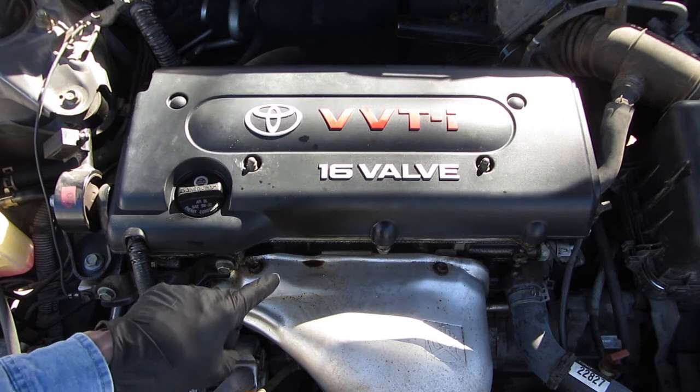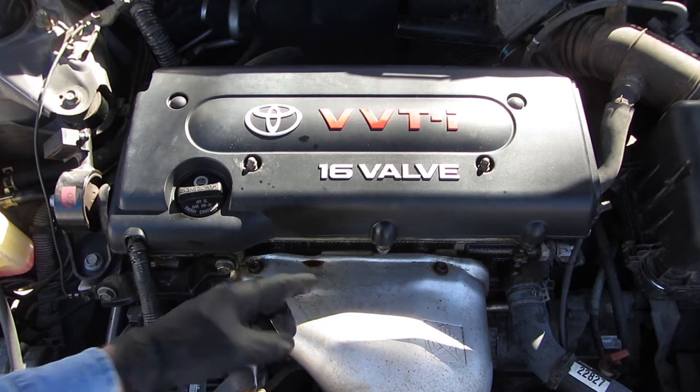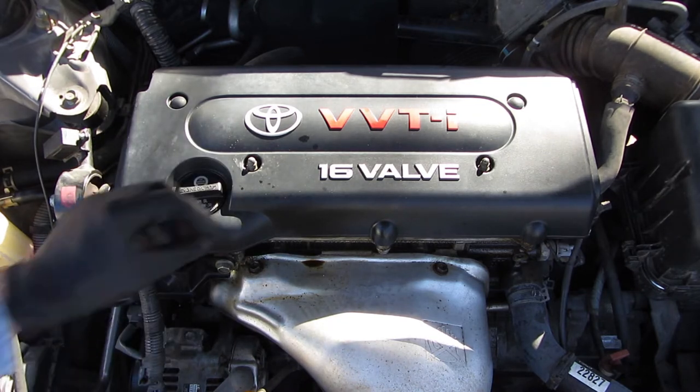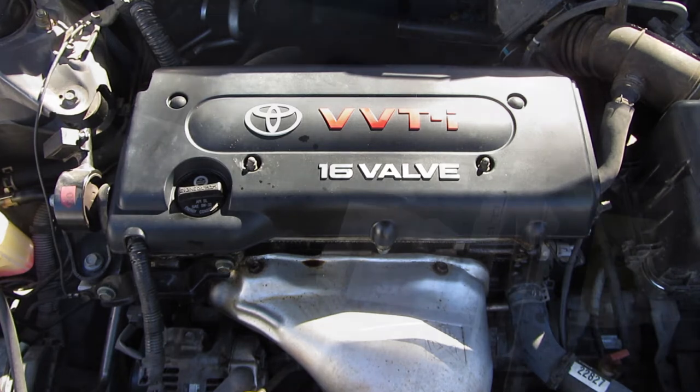It came to my attention when I started seeing a pool of oil on the exhaust manifold cover. I wiped it down and removed the cover and tightened the valve cover bolts, thinking that because three of them were finger tight I could loosen them with my fingers. But I torqued them all down and it still leaked. So I'm just going to go ahead and replace the valve cover gasket.